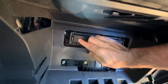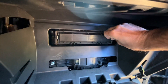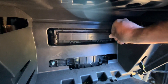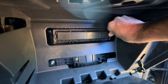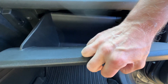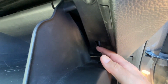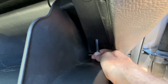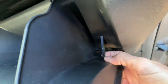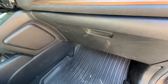Then I'll replace the cover. You want to make sure this is snapped in all the way — like so. Next, you lift the glove box into place until it snaps. We'll take the dampener, place it down towards the back side of the recess, and then pull it forward. And we're all finished.